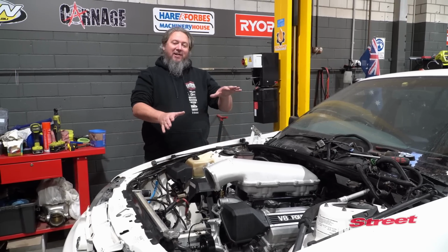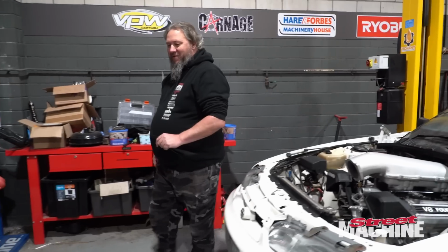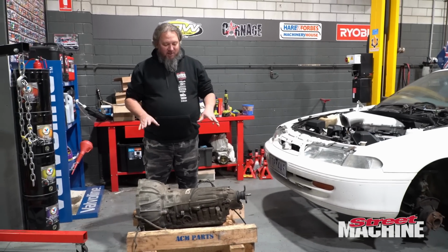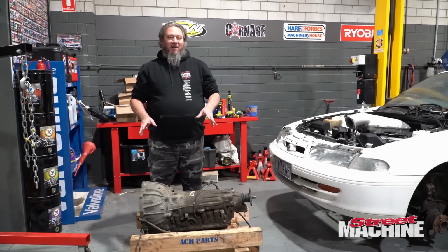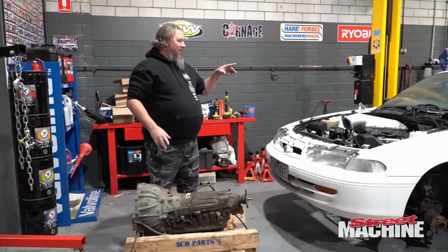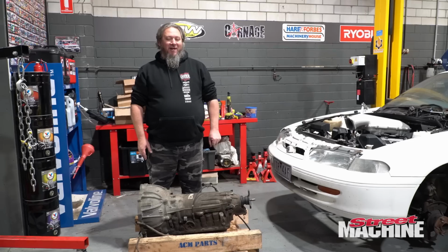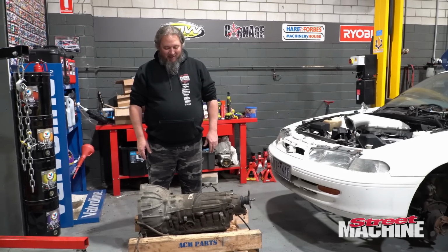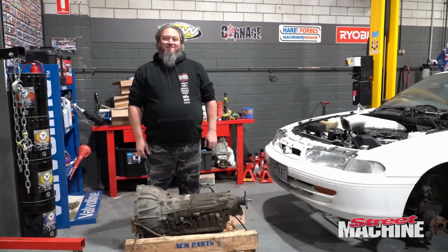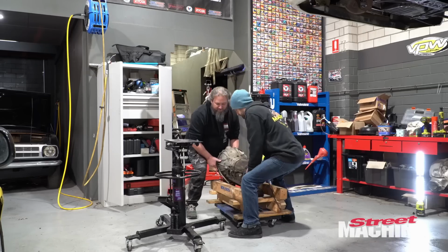Anyway, the moment the engine is sitting slightly laid back, we need to bolt up our transmission, which is sitting here on the floor. So we'll get this up on the trans jack, get the car up, and we'll just put the box in, no converter to start off with, because this is going to have to happen a couple times. We need to make sure it's sitting in the right spot so we can then check out our cam cover clearance. So let's lift this up on the trans jack, get the car up there, make this fit. Good. Yep.